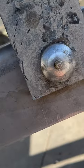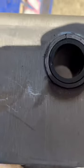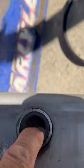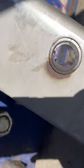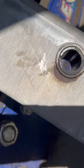These are greasable too, but there's a rubber bushing in these. When that fails, the metal fails because there's nothing else to really press against it — there's no cushion anymore. It's just metal on metal and it's gone.